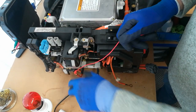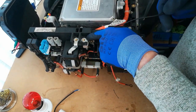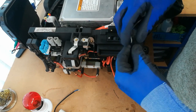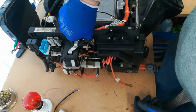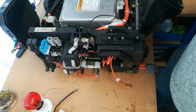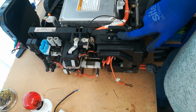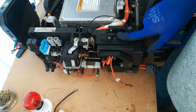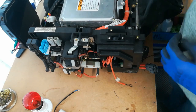The negative is straightforward — it's on the top of the battery at this terminal here, and you can just wedge the crocodile clip down the side of one of these connectors. Once you've got everything wired up, you turn the battery on and then plug in your charger and it will charge. That's the high voltage side done.